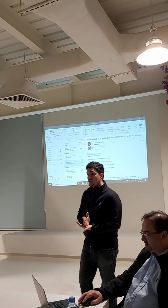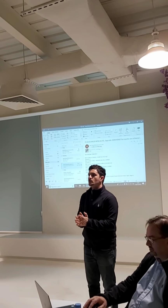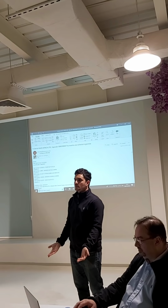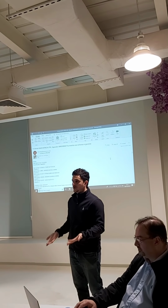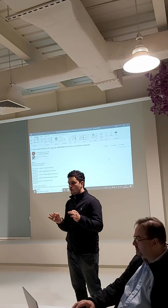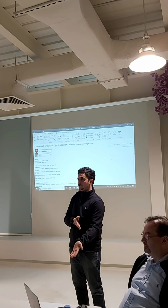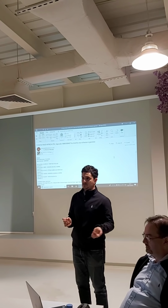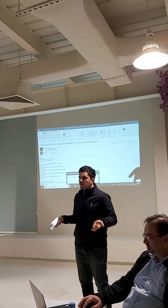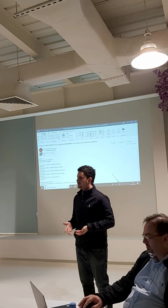And we truly believe in training, because we need to teach you to change the right part. Don't go in front of a machine and change a board. It doesn't work like that. Always go for the cheapest thing first and have a quick look at what the real problem is. If the board is faulty, something made the board faulty. Sometimes the board is faulty, fair enough, but sometimes it's a volumetric, it could be a solenoid. Don't just change the board.